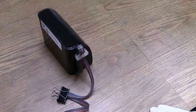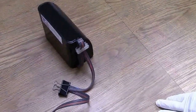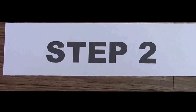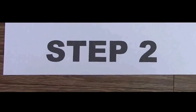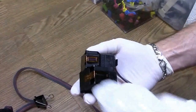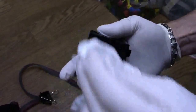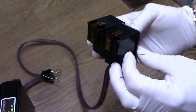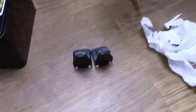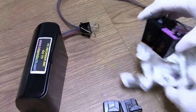Now we'll be ready to install the cartridges without any ink leaking all over. There's a tab on the bottom — we've already taken it off — you have to peel it off, then you want to pat the bottom in case there's any excess ink there. Also, you're going to get these clips and our snap-and-vac, should you ever have to prime the cartridges back up.